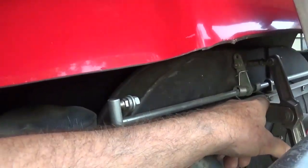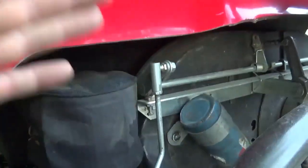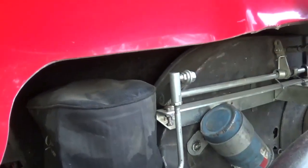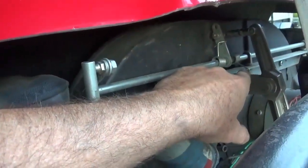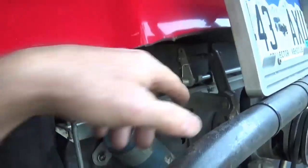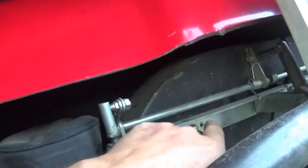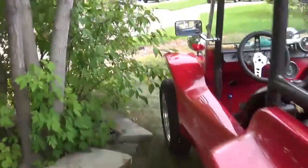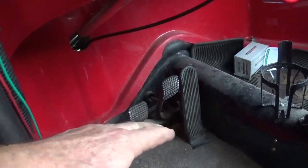You'll rarely have this thing stick — it works great off-road. This is a stock fan shroud setup, made to attach to a stock fan shroud. It uses the coil mount bolt and the two top fan housing bolts above the alternator and generator slot. You might want to add another washer behind one side. The coil bracket fits behind the angle iron to make the same distance. This is an outstanding setup that a lot of competitors made fun of back in the day.